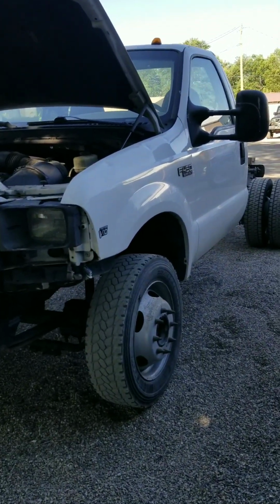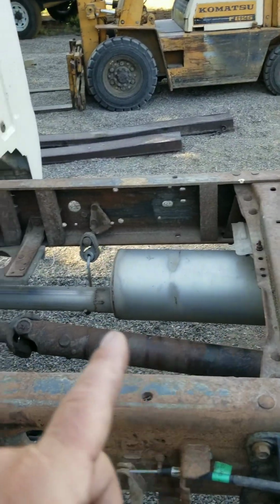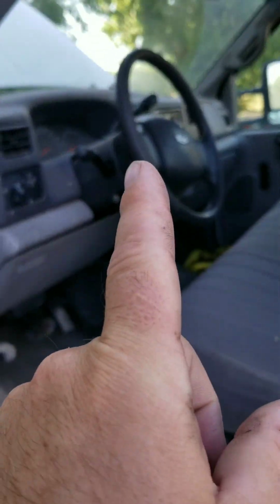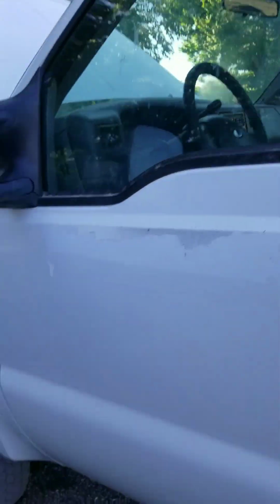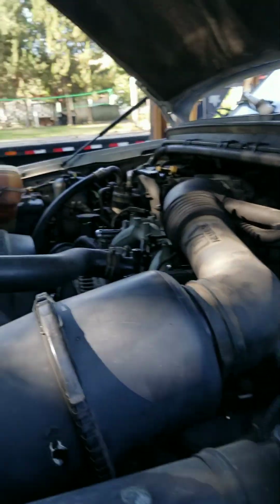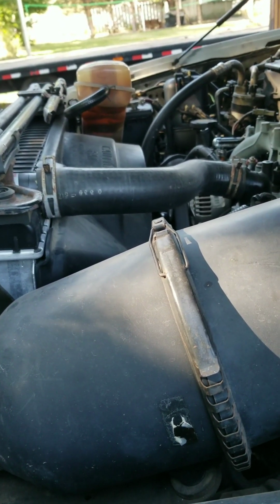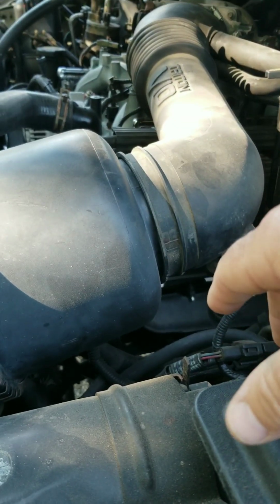So we went through it. Tires, got the rim. We put a new exhaust system on it, since it was leaking. All new brakes, serviced the rear differential, reupholstered the seat, reupholstered the headliner. At the time we detailed it, and had to put a steering column from a van that I have, because it was all messed up. Shocks, like I said, brakes all the way around. The radiator was leaking. Belts, hoses, water pump, exhaust manifold gaskets. Did a ton of work to this thing.